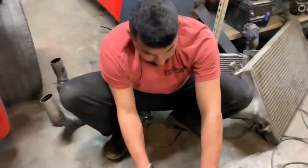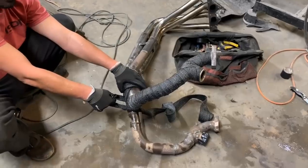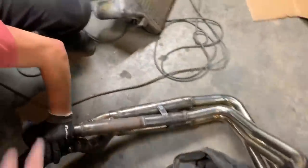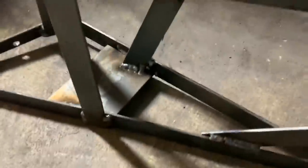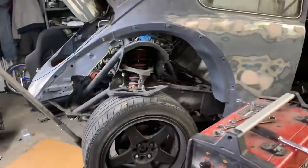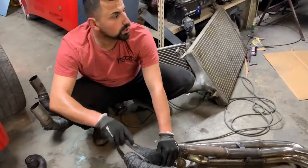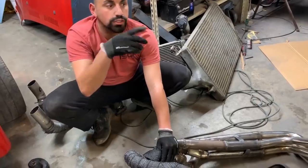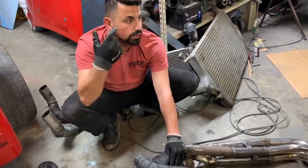Mina's heat wrapping the manifold, trying to make it look a little better. So Mina's doing that because that's the last step for that and then they burn it and it's done. I added that piece right there to help support the cradle a little more. While he's doing that I can start cutting that out of the stainless door. What's left? Finish hooking up the water pump switch, then intercooler piping — it's a different intercooler now — and injectors, and we're done. We got plugs for the injectors, put those in and then we're ready to party.